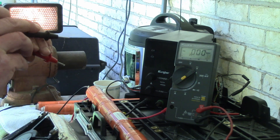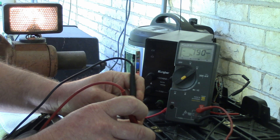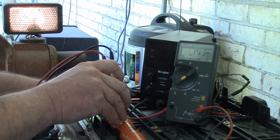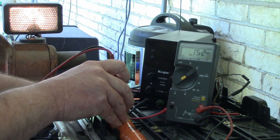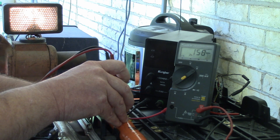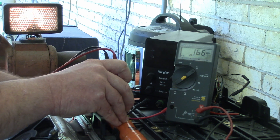So it just occurred to me, I left the discharge on. Let's see how this one is coming. Ooh, look — we're almost to 0.8 negative volts. I bet this one is discharged now. Where's this one at? Nope — this one's only down to 0.1 positive. But you can see, trying to bring a battery pack just with a grid charger and discharging it blindly, you might cause more damage than good. You might be better off just grid charging and not sucking it down too far. Maybe going to 120 volts instead of 0. There's a lot to consider here.